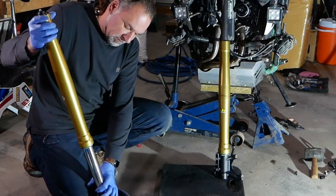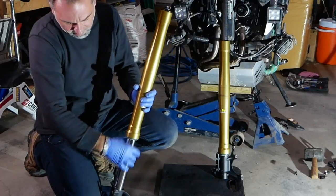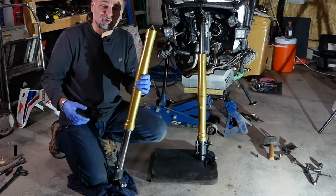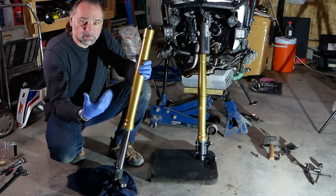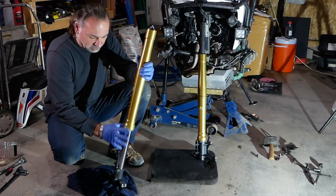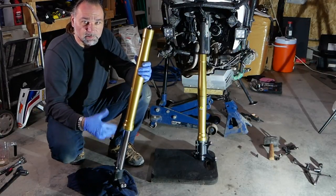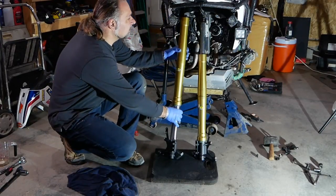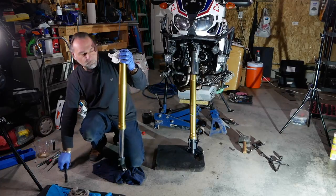I've been quite a bit off-road and have no damage here — the tubes are looking great, and so is the chrome, because the shock socks protect pretty much the whole piece. Just make sure when using shock socks to take them off after major off-roading, because mud can still get in and scratch your forks. Take off those velcros or tie wraps depending on which kind of shock socks you're using. We're done with this fork — I'll tighten the top screw a bit more but won't fully torque it until the fork is back in place.